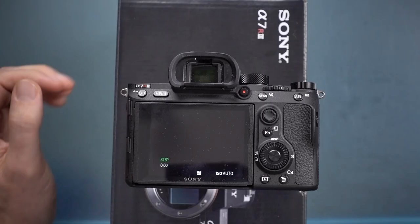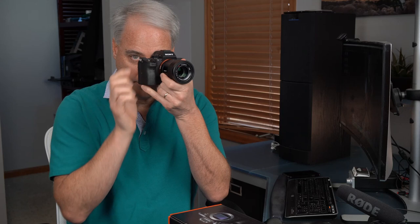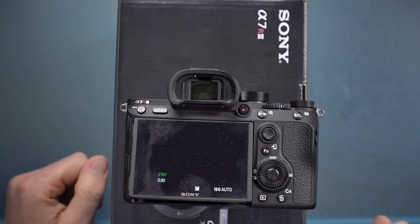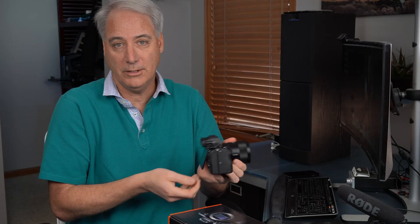Here is your eyepiece cup — you can take it off if you wear glasses. Under it is a rectangular eye sensor. When you're looking at the rear screen, hold the camera up to your eye and the screen turns off while the EVF turns on; pull it away and the opposite happens. There's a nice hidden feature on this camera: if you pull the screen out just slightly from its flush position, the eye sensor is disabled and the rear screen stays on regardless. This is great when shooting with the camera held low — no need to go into the menu to disable the eye sensor.